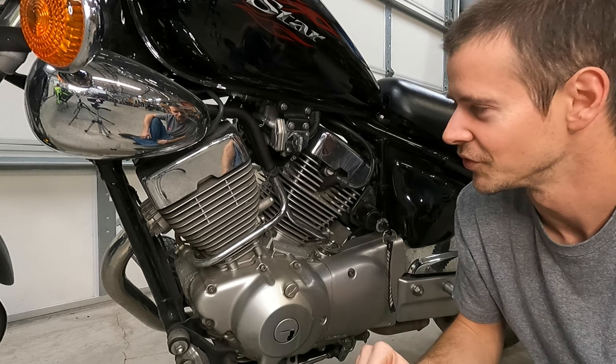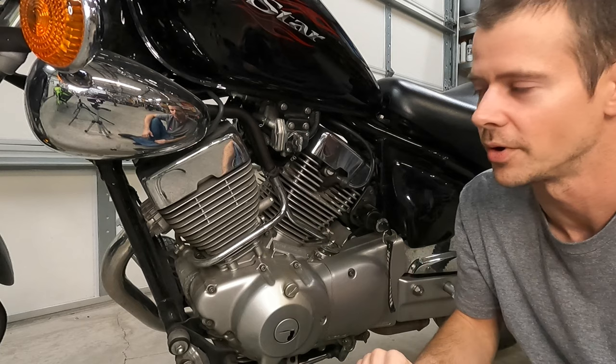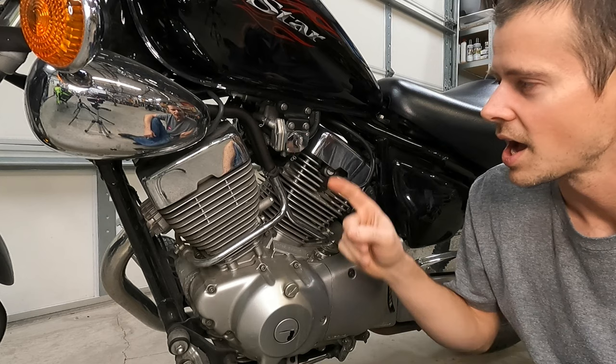We kind of messed with it. You always think it's something horrible at first, right? We switched the petcock from on to prime and then up to reserve. After a while it started back up again and it ran fine the rest of the time. We went out again later and filled it up with gas thinking it was probably just low on gas. Filled the tank up completely. The next day, same problem. We had it back to on when we started, got to the end of the neighborhood, died again.